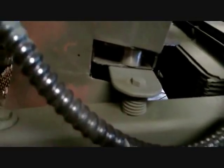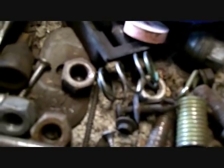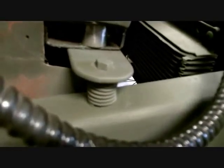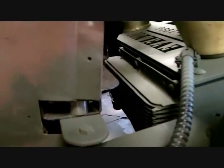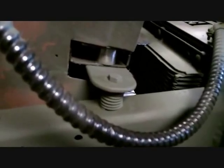Oh, the headlights. Radiator — and right behind the radiator is a 3/16 plate, like I said, welded to the bed rails. Under that, this spring is actually the emergency brake springs from a Pontiac Fiero. I was using GM springs from these things right here — brake springs — but they don't have any oomph to them. This has got a lot more pressure. And the radiator can actually float around but doesn't squeak or jump. That's pretty much how Ford did it — they had a spring and a wooden pad or piece of rubber or something on the Model A. And there's my transmission cooler.